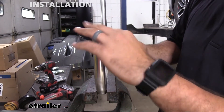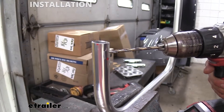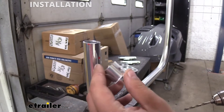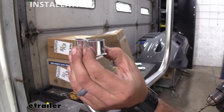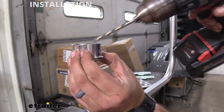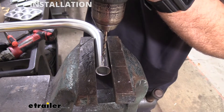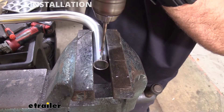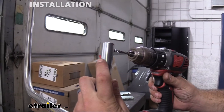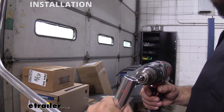I have this cut off and filed it down. It doesn't have to be perfect because you're putting it in a bracket, but try to make it as flat as possible. Now we're going to drill the hole to replace the one that we cut off. Since it has to be aligned, use the factory edge to align it, match the hole with the mark you've made, put a little notch, and drill straight through so you know it's aligned properly. With my mark made I can drill through, then double check alignment on the other end, keep the drill nice and level, and we should be ready to go.